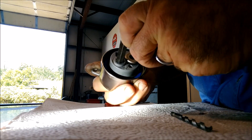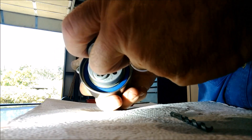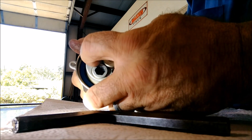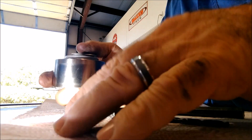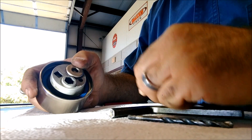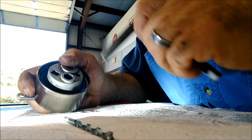Once your five millimeter piece is up in here and you're there, you're going to slowly let off. Make sure it's holding tension — the inside cup has a spring in there that will also help you. Treat it gently. Get your belt installed. Re-check all your timing marks several times, especially if you have a 150 like mine. They are interference fit motors and will destroy themselves if this is not done correctly. Once you've got that all done, take a little bit of tension off your holding tool, remove your holding tool, slowly release, and re-check all your marks.